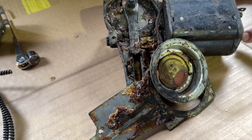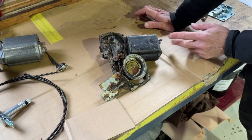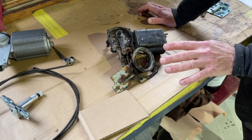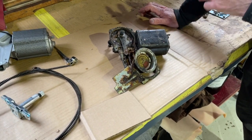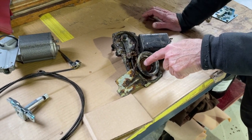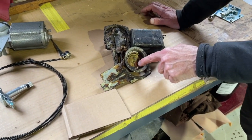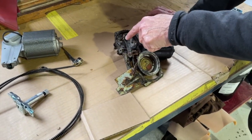When you turn off the switch that feeds the power into the back of the motor, you energize this circuit, and then this finger, when it hits this red spot, stops. This takes over and dictates. You've turned off your wipers, but they're still moving. Surprise, surprise. Why is that? Because you've energized this disc and it's feeding power through this finger. When it reaches the red spot, no more power because it's non-conductive. Wipers park.